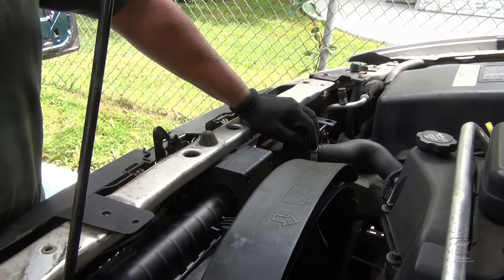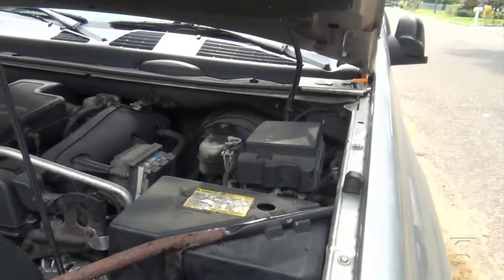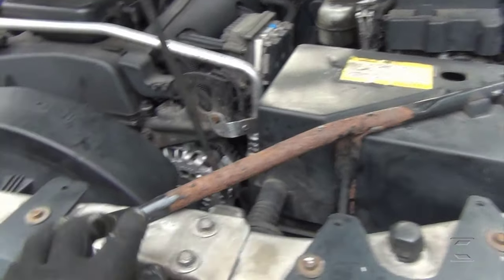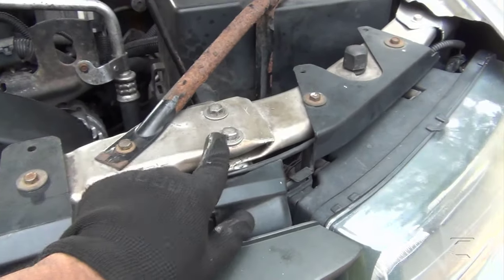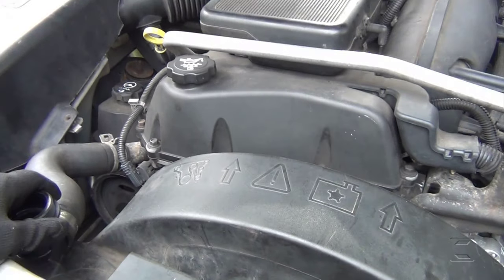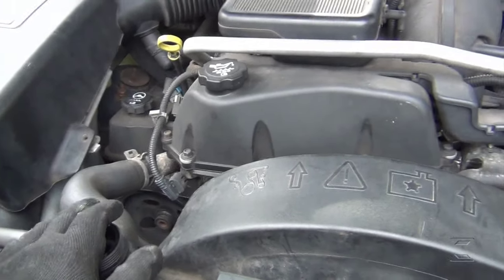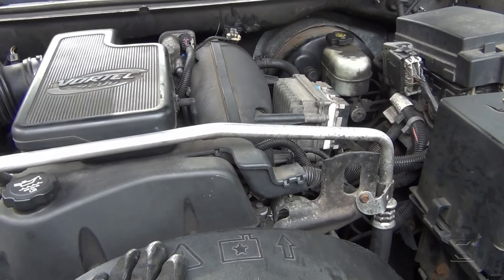And then fill up the radiator. Make sure you bleed out the radiator. Okay, just really quick. I bolt down right there. This here. This one right there, the 13. I mean, this one, I didn't touch them. Here. And I'm gonna replace a little bit of oil that came out from the transmission, less than a quarter. Before replacing oil, I'm gonna check the oil first to see how the level is. I'm gonna replace whatever is left to replace.